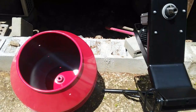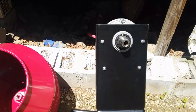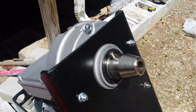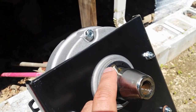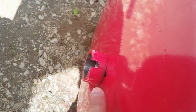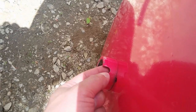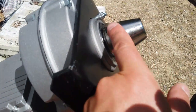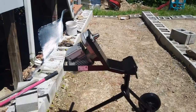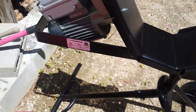Next step is to install the drum. You can see where the drum is going to go right here. There is one little thing to notice — this piece coming out needs to fit here. You see this notch — they call it a guide notch. When you lift the drum, you need to slide this piece in here so it aligns correctly once the drum is installed.